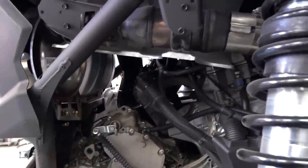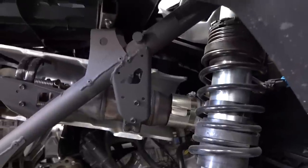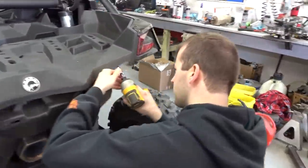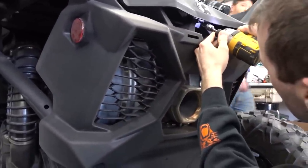3RWI time! We got to get the injectors out of the rail, take the stock catalytic converter off and put a cat bypass pipe on it, and add some charge tubes — those aren't too hard to get at. Rick, you excited? Yeah, really excited. At 5.33 stock that felt good — I'm hoping to get it under five. We got that in there for sure. Step one: take all the stuff off the back so we can loosen up the muffler, then get to the cat. Just getting all the T-30s off here to get that muffler shroud off.